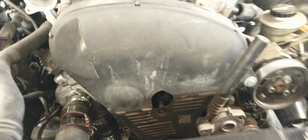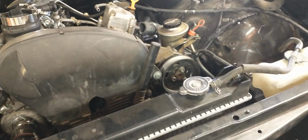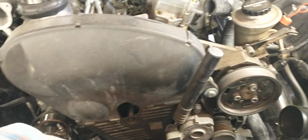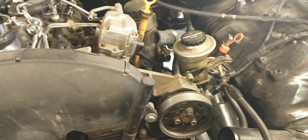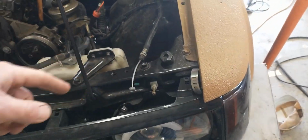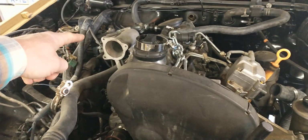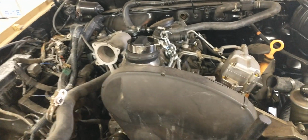And then we're actually using a Honda Prelude air filter box, which is going to come across the front here and sit on this side. And then you can see the same cuts through the wheel well, and the other side of the intercooler pipe will come up and 90 right into the EGR delete on the intake.